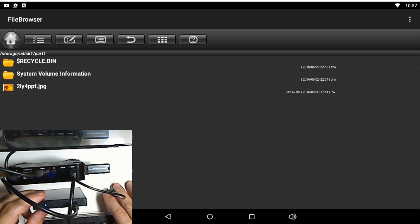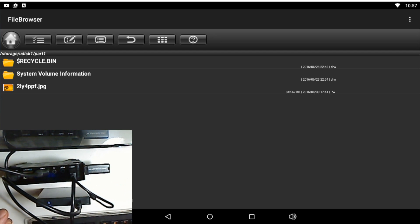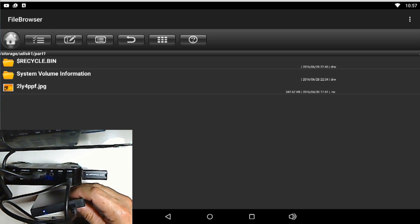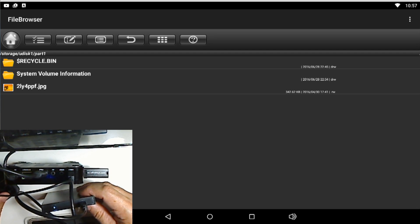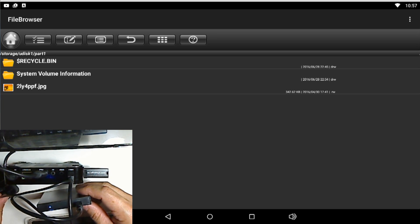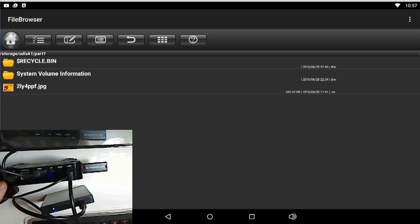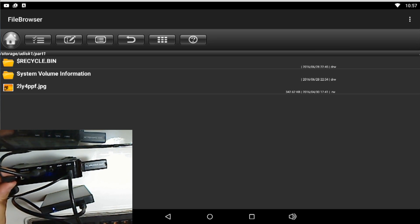Some 3.5-inch drives have their own power supply built in — those are great. Someone asked me: 'I take the power off my box and it's still on — why won't it turn off?' Well, because the box is now being powered through USB from the hub. Let me demonstrate: I'm going to plug the box into this little hub, and everything is still working. Now I'll remove the main power from the box — watch both screens. Look what happened: the box is still working!